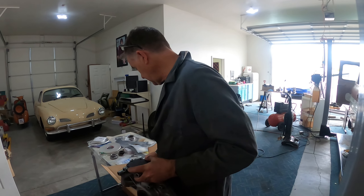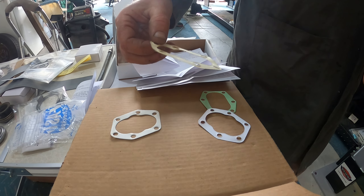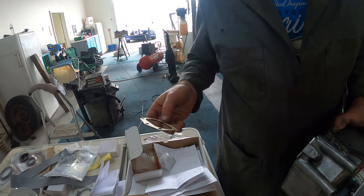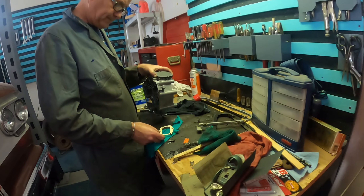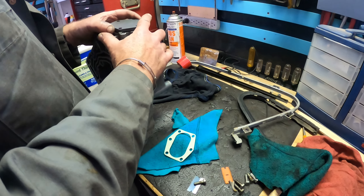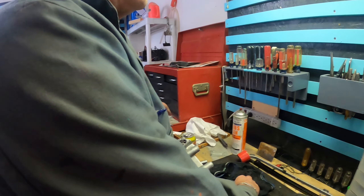So what's the clearance we're looking for? Two and a half thousandths of an inch. I'll come over and look at my gaskets — these are all the different gaskets. According to my calculations, they're not marked as to which is which, but I measured them earlier. I want to take this green one — we're going to try the green one.